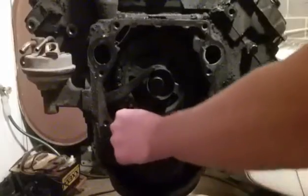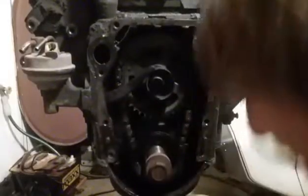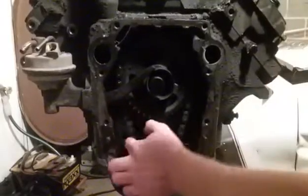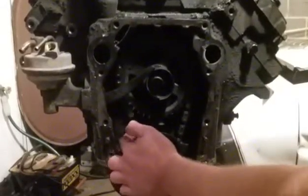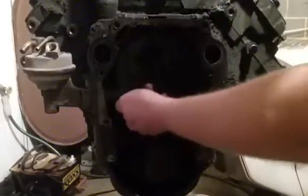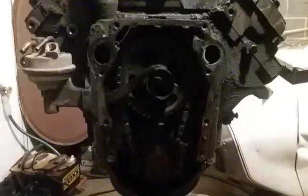That's slack right there. I'll move to one side. Yeah, there we go. There's more slack right there. Yeah, I'd say the chain's dead. So this is the teeth right here, saying they have nylon coating around them. There's no nylon left. It's all down in the pan.